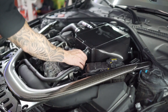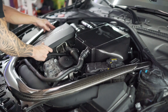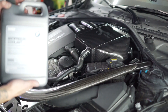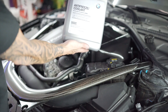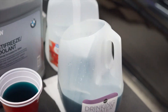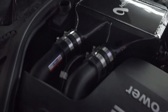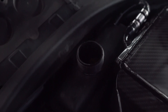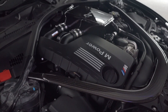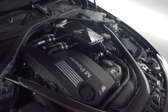Everything is lined up — make sure you check all the hoses and clamps, nothing's loose, charge pipes and J pipe are good. All we have left to do is put on the engine cover and then top off the coolant reservoir. Make sure you mix your BMW coolant antifreeze with 50% distilled water and then top it off to the fill line. I have my coolant and distilled water mixture and I'm pouring it in with a red solo cup right into the coolant reservoir. There's a little meter inside — you want to pour it so it barely covers that.